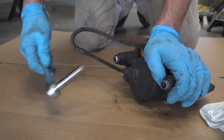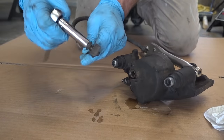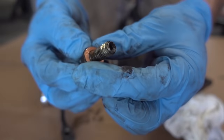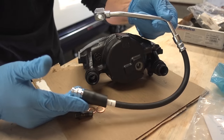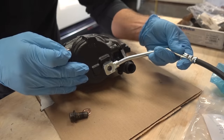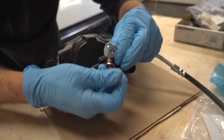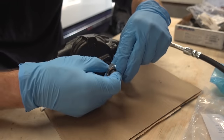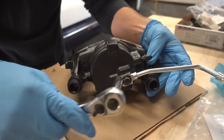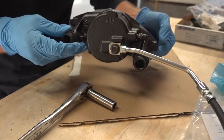Now the object is to remove this bolt — it's 11 millimeter — just like that, it comes off. These bolts use copper crush washers, and you're going to want to remove the old ones and have new ones on hand. To install our new flex line, we need to make sure we have it in the correct orientation. I double-checked before I took my old stuff apart, so I know this is the correct way it goes. I'll take one copper washer, slide the other onto the bolt, slide the bolt through the flex line and through the other copper washer, then start it by hand, being sure I'm not crossing any threads. Now that it's hand tight, I can crank on it with my ratchet. One flex line installed onto a brand new caliper.